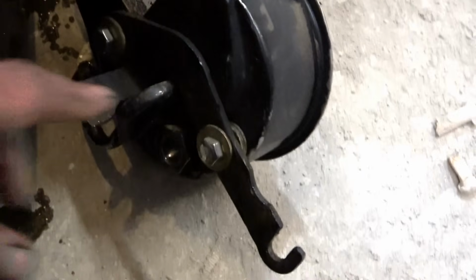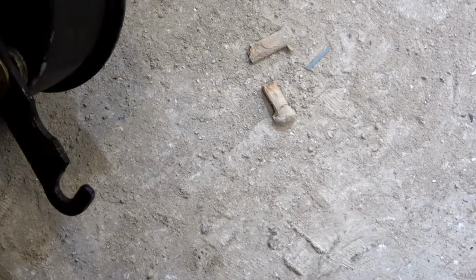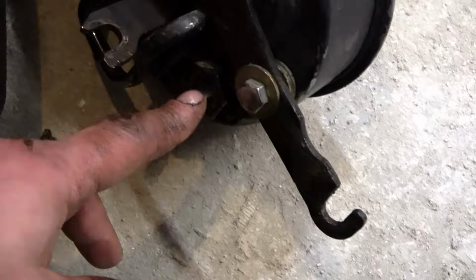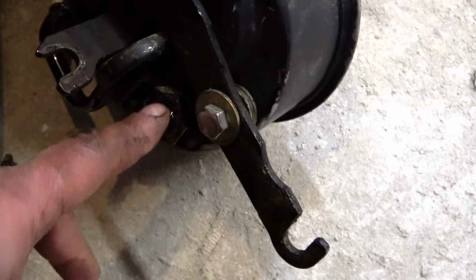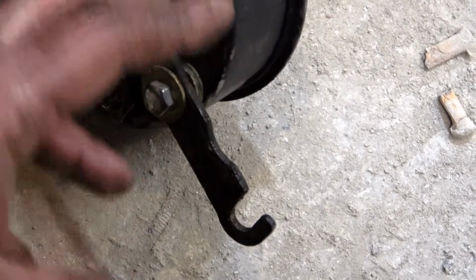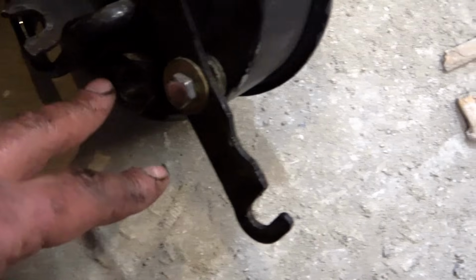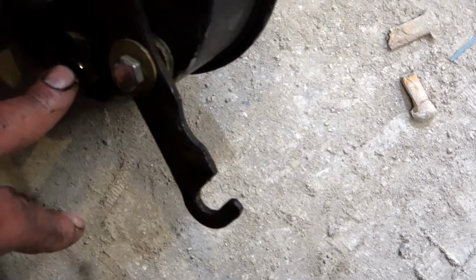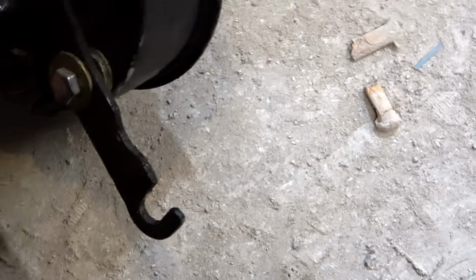Got the power steering pump out of the truck. You're going to have to remove the 2 bolts. The line bolt here for the high pressure line is a 16mm. Now, it's hard to get to. Your best bet's going to be to pull it loose from the bracket, wiggle it out, and then undo it where you can get to it. And before you put it back in, attach that line. You're going to save yourself a lot of headache.